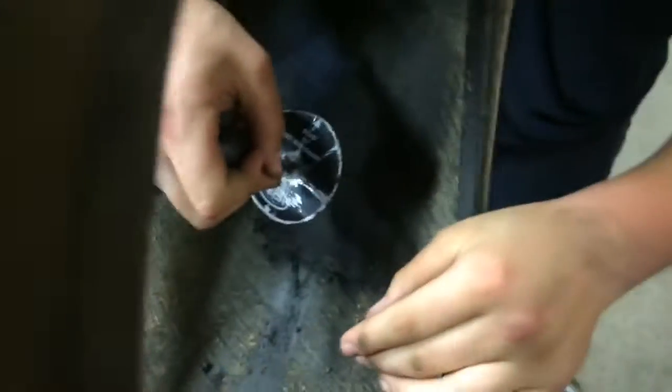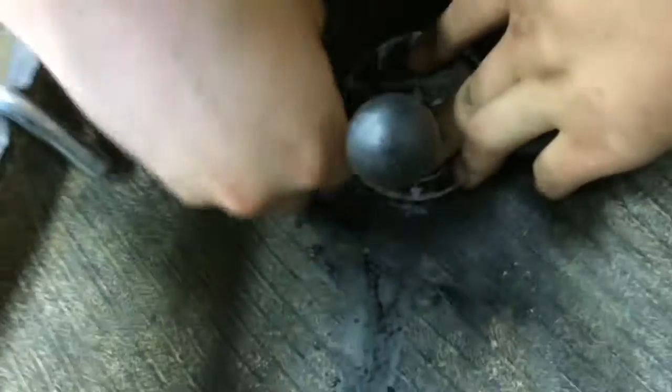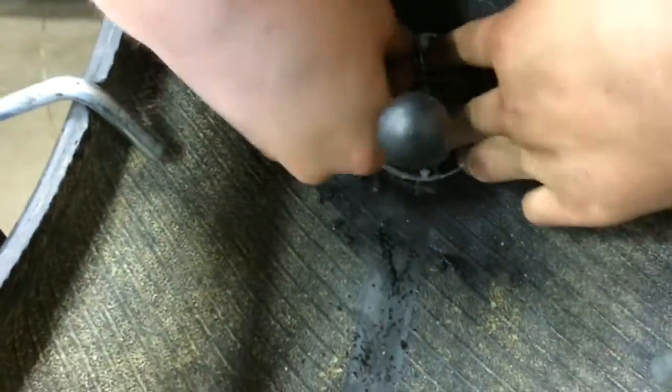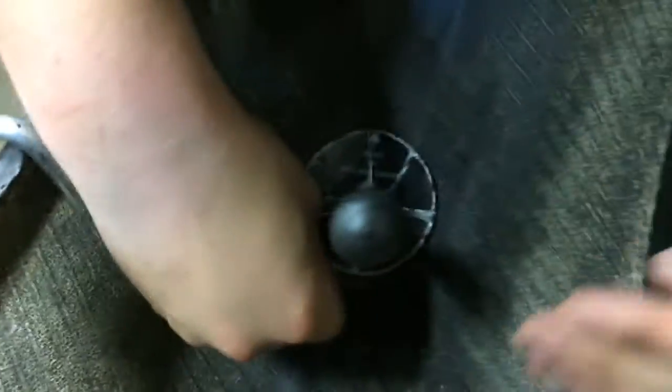You're going to grab your little tracer here — it has a circle on it. You're going to put this right through the hole, kind of push it down. You don't want to full-force push it; you just want to have it straight. Then you're going to circle your surface to mark how far you're going to grind out. Kind of gives you a slight idea.